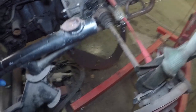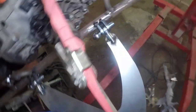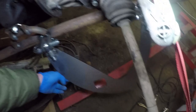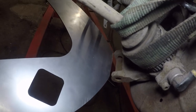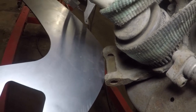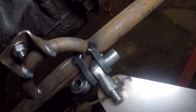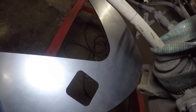About 15 minutes later and we have an arm on the thing. Ignore the fact that I've used rose joints as bolts — I don't have any M16 bolts at the moment — but they are tacked on and the arm does a droopy thing. It's pretty much spot on to where it wants to be. It needs to be a little bit longer but the threads are all the way in, so you just wind them out a bit and it's pretty much where it wants to be. I had to just take the tip off one of the brackets to clear the engine mount tube, but it is what it is. Now I've got to work out how to attach this end.